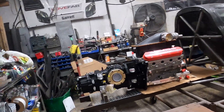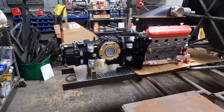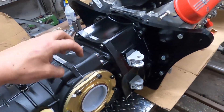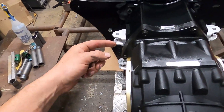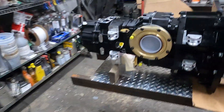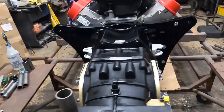I think they're affected by COVID, which is what it is - I'm not going to talk bad about them, but I sure wish I had those shocks. I have to finish the front and fabricate the whole back of the car, which is 100% reliant on having those shocks, because the rockers need to go basically here. We'll have tubing going up, drill and tap a rose joint, bolt through there, then come forward and mount the rocker cups - they kind of weld in and allow the bearing. Less than 10 pounds to mount the rocker, which is cool.